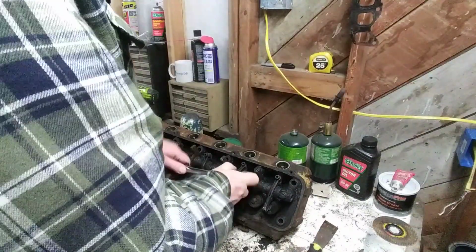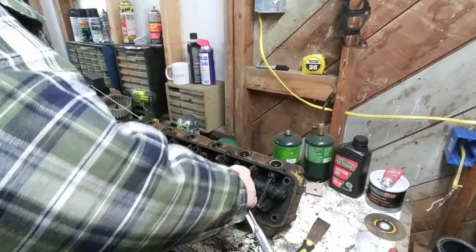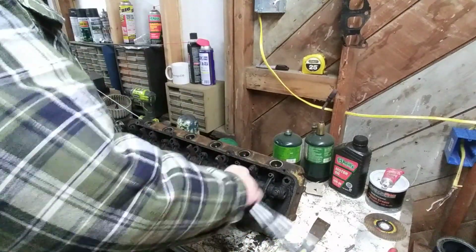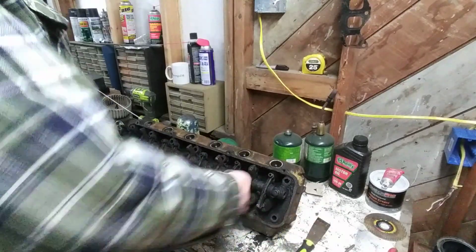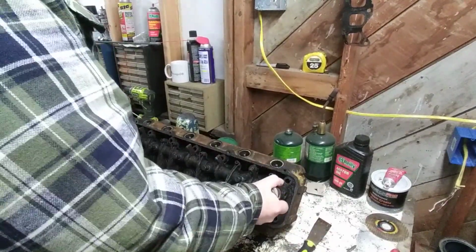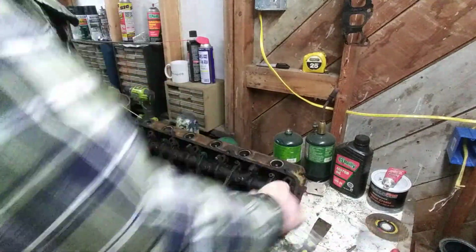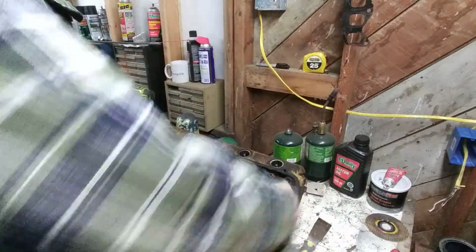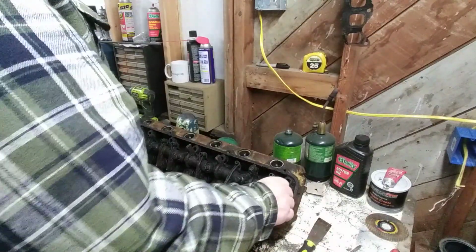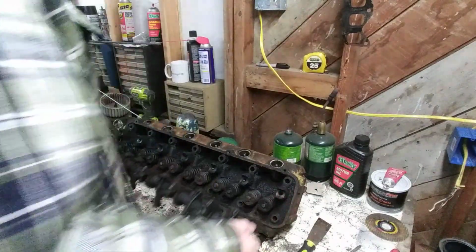And then they did the reverse hydraulic thing where the lifters are oil powered, the hydraulic pressure for the lifters came through the rocker arms down the push rod. Kind of an odd way of doing it. I guess it kept them from redesigning the block again. But by that time, they decided the Slant 6 was on the way out. Chrysler had gone broke by then, and everything is K-cars after it, like a truck. Okay, there we go. Let's get rid of this.